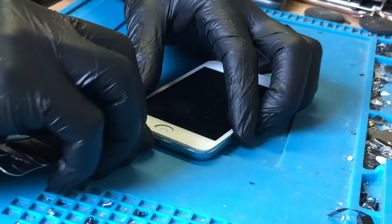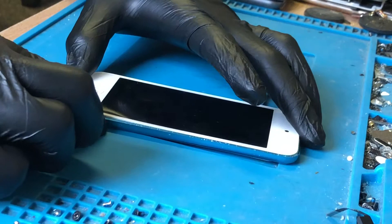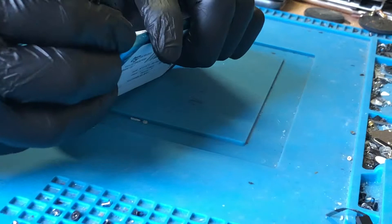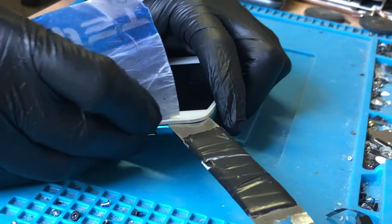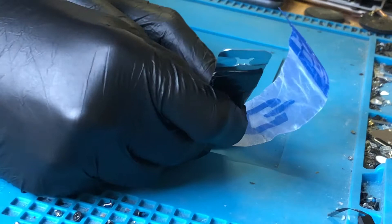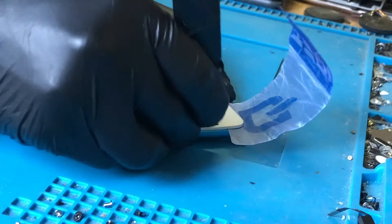The bottom is done and around the sides it's just a case of unclipping. I'll get in here and put something there to keep it up, then work around the edge. You have to be careful because the frame is tiny and you don't want to damage the LCD.